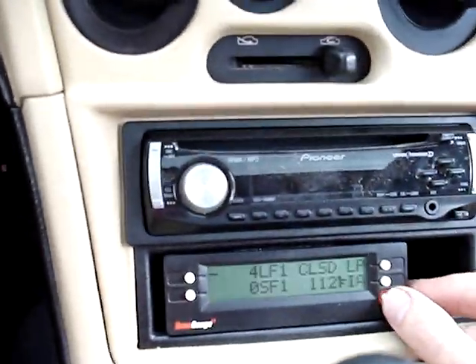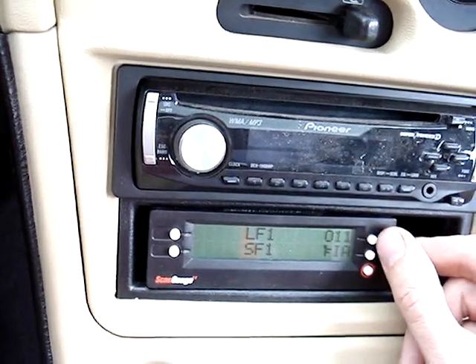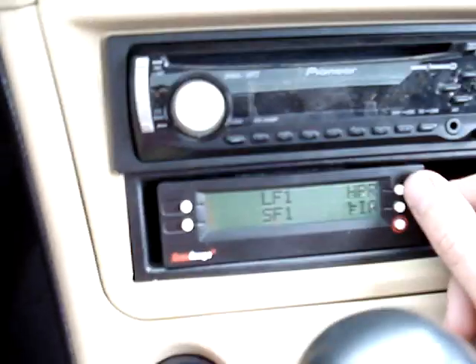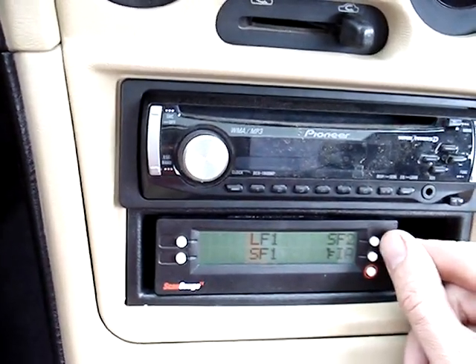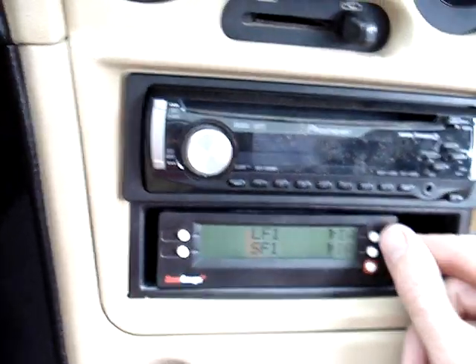This scan gauge is pretty cool — it has a lot of features. You've got your fuel trim, closed loop, open loop — you can monitor that. You've got your MAP sensor, miles per gallon, miles per hour, RPM, throttle position sensor, water temperature, O2, fuel trim, and horsepower. It tells you the horsepower you're drawing while you're punching it. And your voltage — your battery voltage.